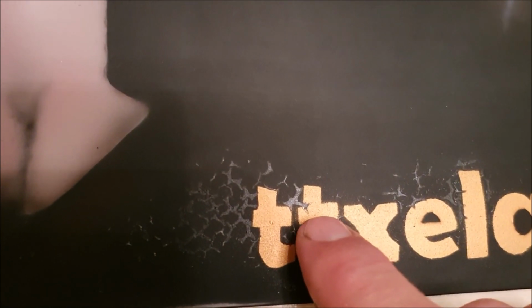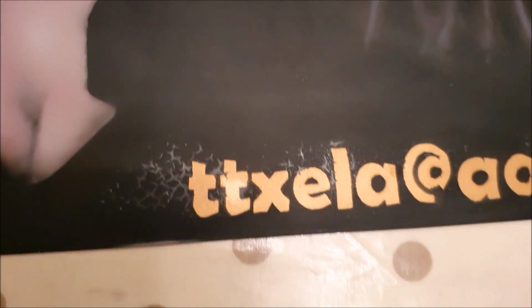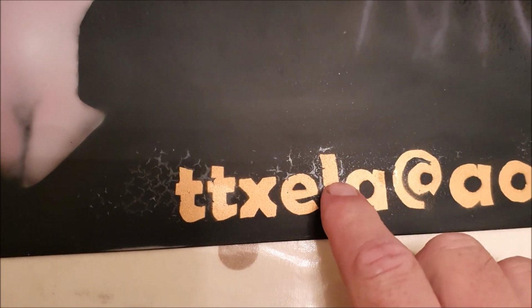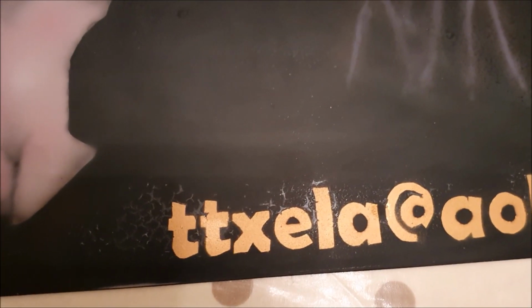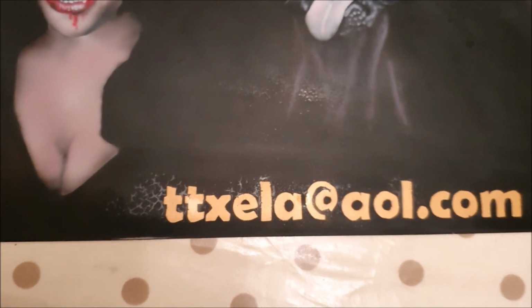And it's also lifted the metallic paint underneath where the clear coat has sort of wrinkled up. I'm still not sure whether that's because I put it on a bit too thick or whether it's a reaction with this gold paint, but that seems weird because everything's fine at the top. Or whether there's some contamination got in on the bottom there, I don't know. It's all very odd. So how to fix this?